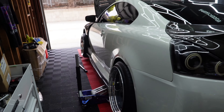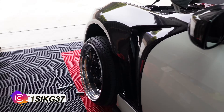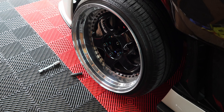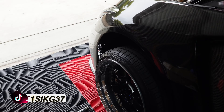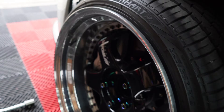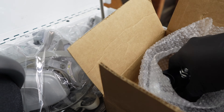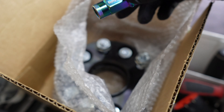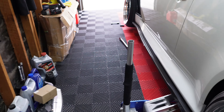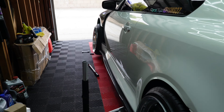Welcome back to the channel. We are changing something real quick for the G37 — I don't hide anything. I'm using spacers on my Workmeisters due to the face being low disc. Remember, these wheels used to be on a 350Z, so it's a different fitment than the G37. I'm only using spacers on the front ones. One of the threads gave up, so I need to switch it. I got a new one, went ahead and got a spacer for it and the lug nut as well. These are 25mm spacers at the front, just to achieve that fitment fender-to-lip on these carbon fiber fenders.